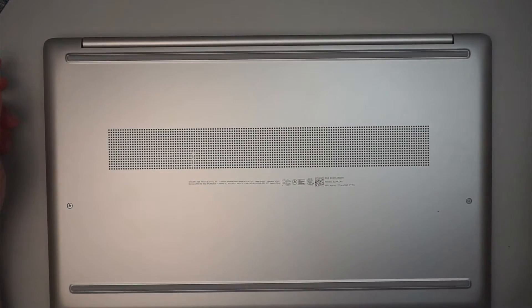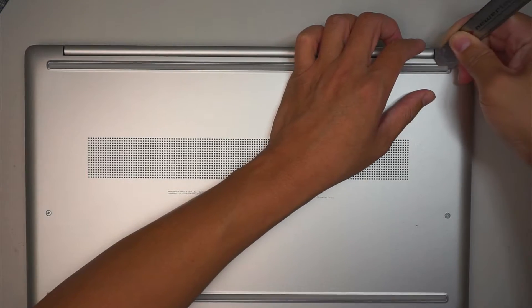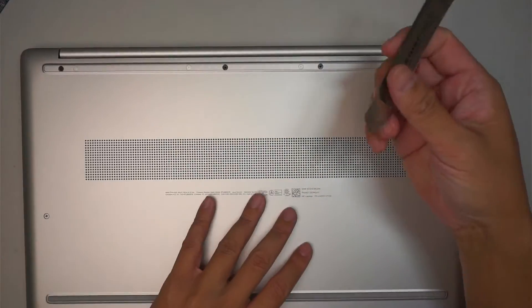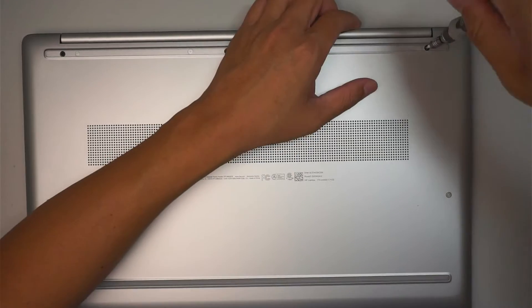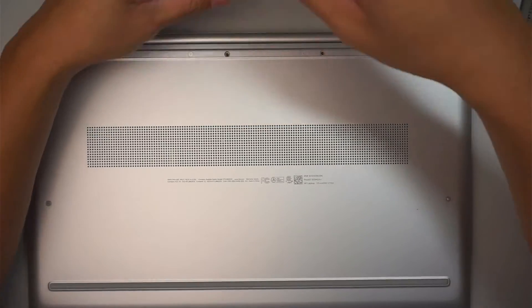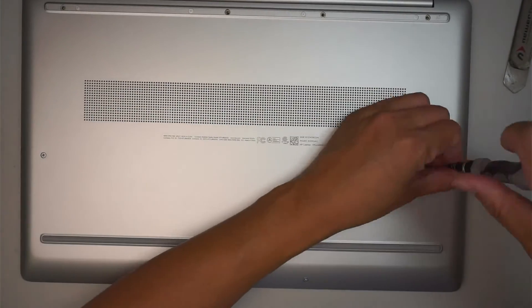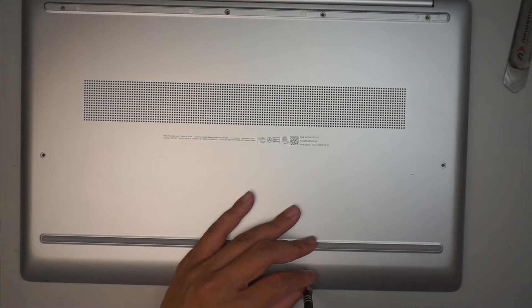The first thing you need to do is remove the rubber here. This is a stopper to prevent the computer from sliding away. There are hidden screws underneath, so to remove it you just have to get a prying tool to go underneath and pry it open. They might not have a screw at the bottom but we'll find out. Get a Phillips screwdriver — I'll be using a PH1. Go ahead and remove the screws. You'll notice the screws on the top are black and the rest are silver. There are four screws on the top, two screws in the middle center, and two more at the very bottom in the center.